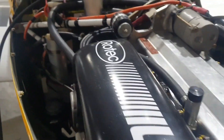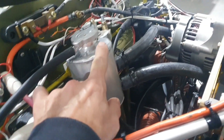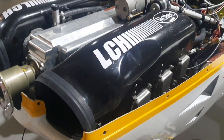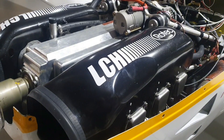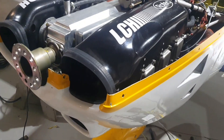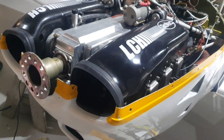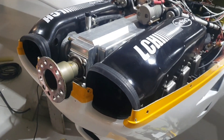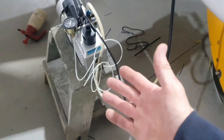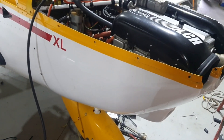The last phase is going to be interesting — we've got a vacuum pump hooked to the header tank with a little interrupter washer in there that allows the vacuum to pull on the header tank but not leak out the cap. Hopefully that'll work. The way it works is there's an airline venturi system which creates a vacuum and pulls air out of the header tank or coolant system, then you shut off a valve to trap that vacuum. I've got a vacuum pump so I'm going to vacuum the system for a few minutes to get as much air out as I possibly can.